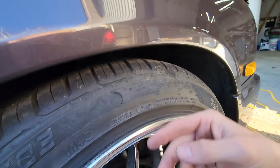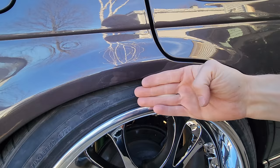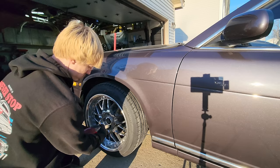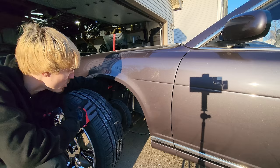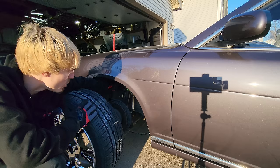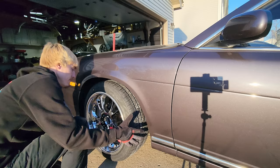Let's take off the wheel and slam the fronts now. This is a 17-inch wheel in the front so it's not the same comparison — that's over five fingers, which is way too high. In the rear we're looking at about three fingers still, though the suspension still has to settle since it was just jacked up. I jacked up the front which means all the weight's on the rear. Let's verify we have the wheel build in the correct spec to clear the coilover up front, because when I first got these wheels the fronts were too wide and hitting the coilovers. Hopefully we got our measurements right and got it spot on.